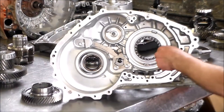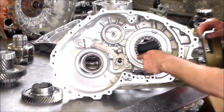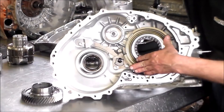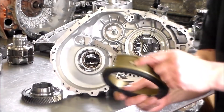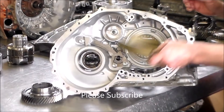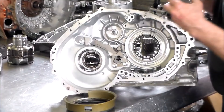On this section you have the B3 piston that's going to sit right here. Here is the new piston — it has a little tab sticking out, and this tab is going to sit right in this notch. When the piston sits in here, the opening faces here so when the transfer gear goes in it won't hit the piston. There's a little notch cutout right here where the tab is going to go. That is the B3 piston. Then you have your return spring, you press it down, and put your snap ring in.